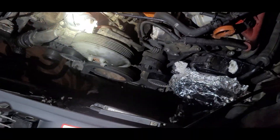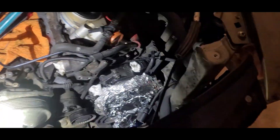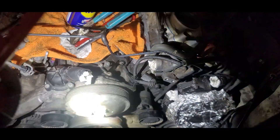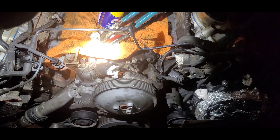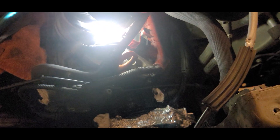There's plenty of space now — an unbelievable amount. The only reason I actually took this out further was the radiator pipe and this hose that connects from here to here. If you need to access the high-pressure fuel pump, the vacuum pump, or the thermostat, there's just no way to do it without moving the bumper out.